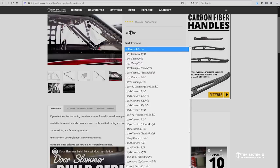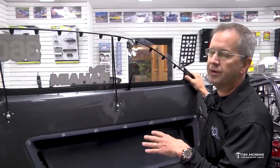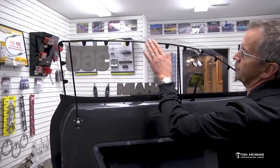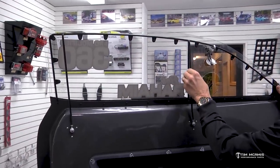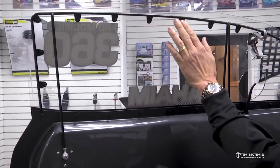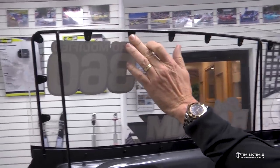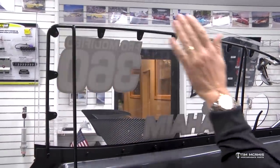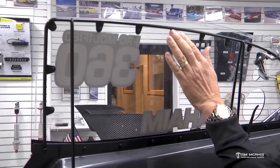It still needs some fabrication, but a lot of the engineering is done for you. What you're going to get is this is quarter inch 4130, it's 049 wall, so it's real light. You're going to have tabs that attach the window to, and you can even see the nut on the inside here. So you're going to get this part of it bent and the tabs welded on.